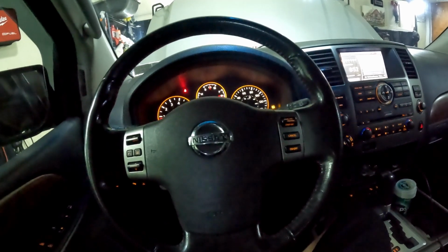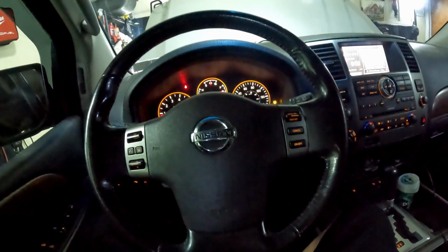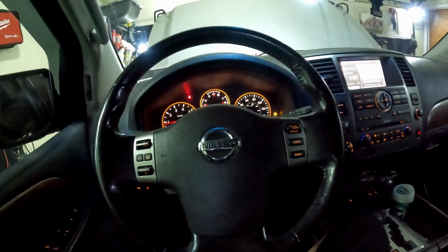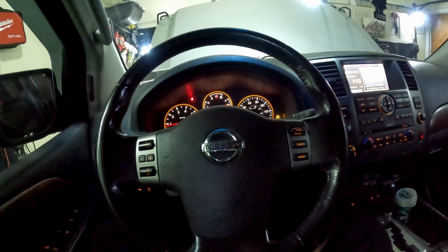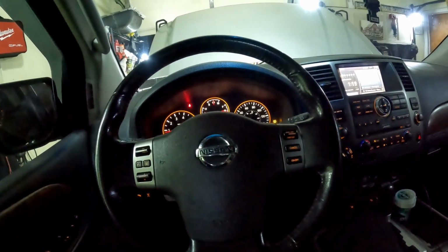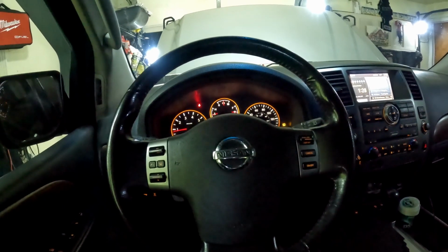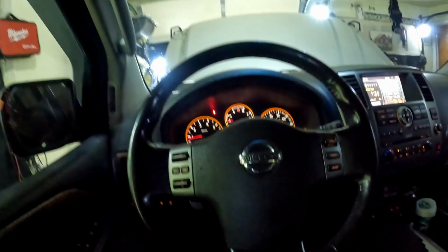So I mean, the vacuum pump did what it did and it does what it do. So you still need a vacuum pump regardless when you're doing AC work. So it's not like the vacuum pump failed or anything. It's just that was a really slow, super duper slow leak. And again, I didn't see the residue because there wasn't any refrigerant in there to begin with. So yeah, this was basically a video of fixing my, I don't know if you want to call it a mess up or not, but yeah, it is what it is. So now we got cold air once again.